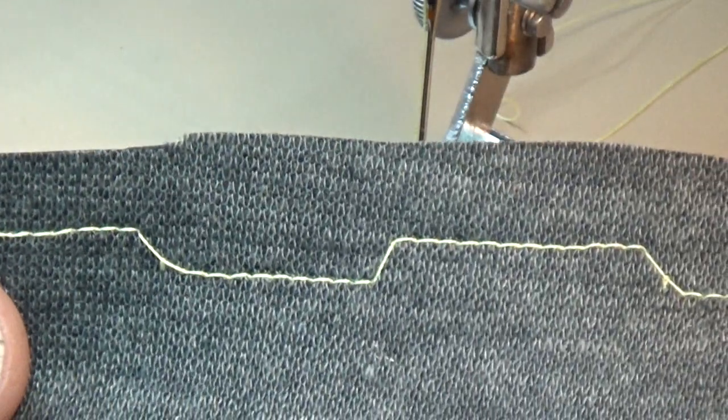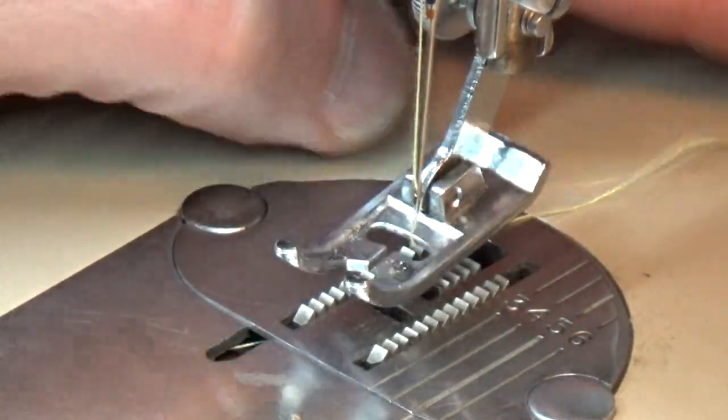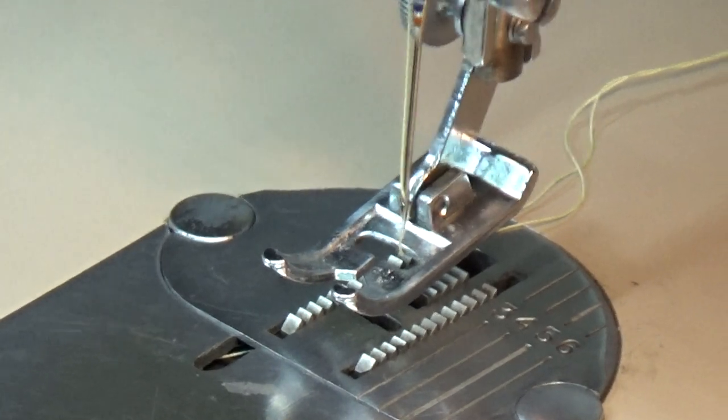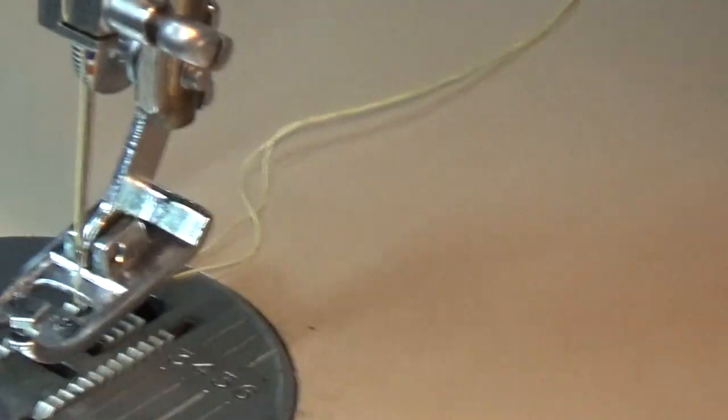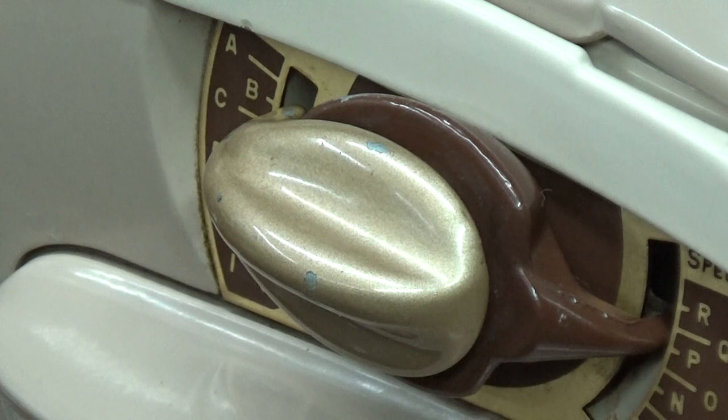And there's our lock stitch, no difference. Absolutely gorgeous lock stitch as well. And the way you access these cams, and again, I'm really nervous about this battery. I don't know what's going on. Maybe my battery is starting to croak or something. Is right in this region right here. The gold knob is going to control the left. The brown knob is going to control the right. And then inside of the top of the lid, they've got a quick reference as far as the settings for the cams that are built into this machine.